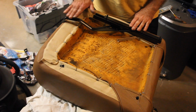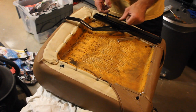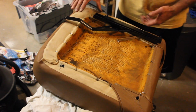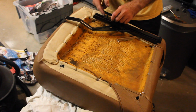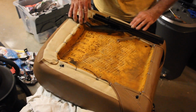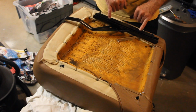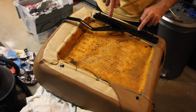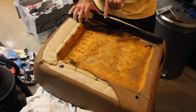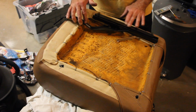I've already powder coated this piece. There isn't anything plastic in here. There's only grease on the inside, so I wasn't concerned about really damaging anything on here. And then what you want to do is, before you install all of this, there's 1, 2, I think 4 potential ball bearings on the inside of this rail that glide along between the 2 rails themselves. And I believe there's a roller bearing on the inside of this bottom support. You want to get as much grease in here as you can so this thing slides really nice and gently. You don't want any friction on this.